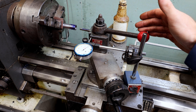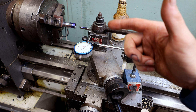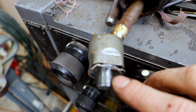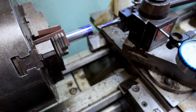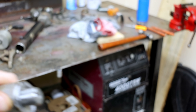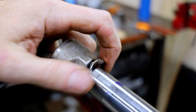It's been probably 10 years since I cut an internal thread and I've never cut a metric thread, so I didn't record it because I was giving it my full attention. The thread fit came out pretty good. I nicked the end of my tool so the root of the thread wasn't cut quite as deep as it should have been, and when I threaded in my tie rod it wiped out a little bit of the crown on the thread. I don't have enough experience threading to take the tool out, resharpen it, and get it lined back up again. This is only about the third thread I've ever cut and the first internal thread, so for me this is good enough. I'm pretty happy with the fit — I could screw it together by hand, but it's tight, which is a good fit on the thread.